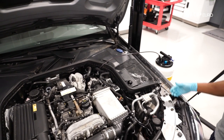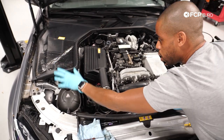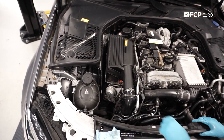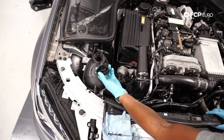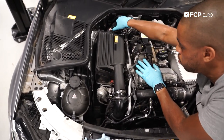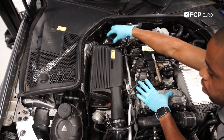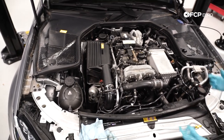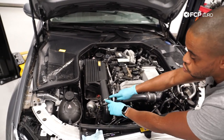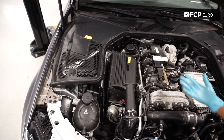What I like to do while the oil is extracting is take a look at everything going on in the engine bay. We have reservoirs for the intercooler circuit as well as for your radiator's regular cooling circuit — don't be afraid to open them up. Crack it first to release pressure if the engine's hot, then open it up and glance at the fluid level. In this case the color and level is correct. Do the same for your intercooler — make sure fluid's in there and it's the right color, like a pinkish color. If this is the second or third oil change you're doing, you should also be considering changing your engine air filter. Very simple once you've already gotten the snorkel removed — there's one screw here, two here, and the electrical connector for the temperature sensor. Remove those and the box comes right off.